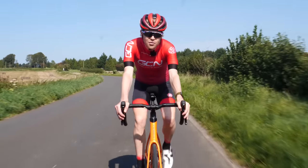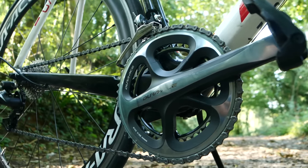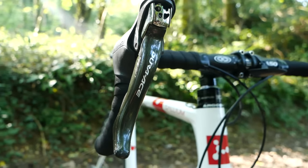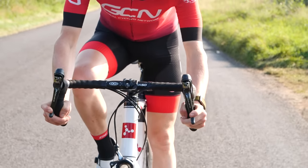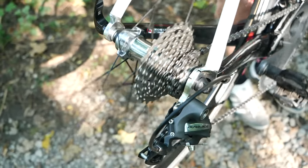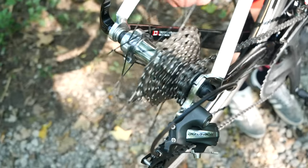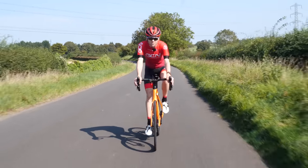What can we conclude from this? Which is the better groupset? Well, Dura-Ace is still lighter, but not by much, and it still shifts absolutely beautifully. Surely a testament to the quality and engineering, considering that it's over 10 years old. It's also probably slightly mechanically more efficient in terms of drivetrain efficiency than modern 105, but considering the specific example we've got is over 10 years old, they're probably similar now.